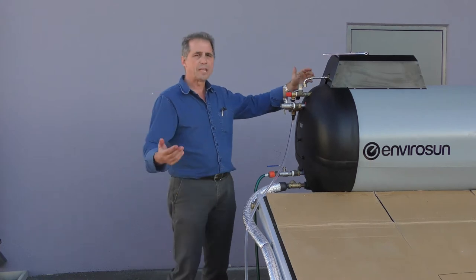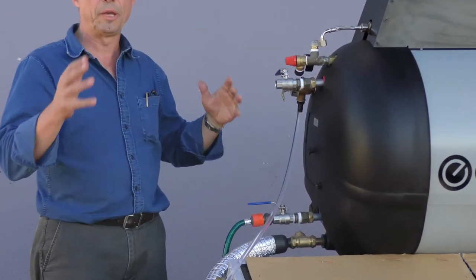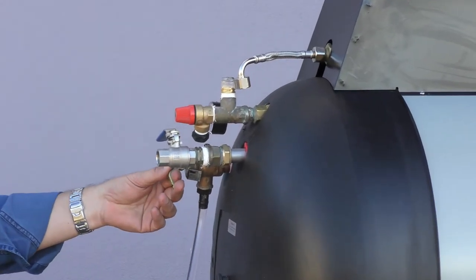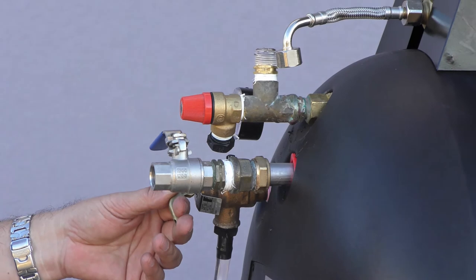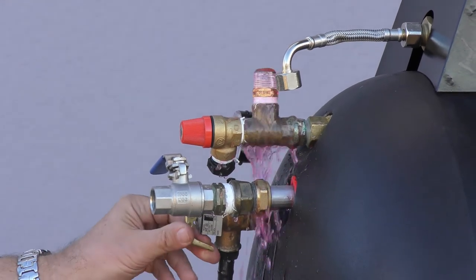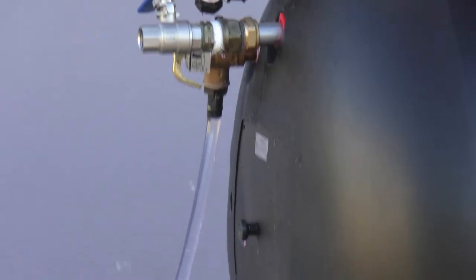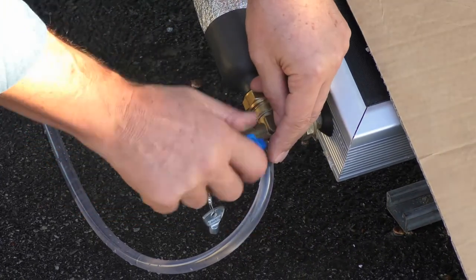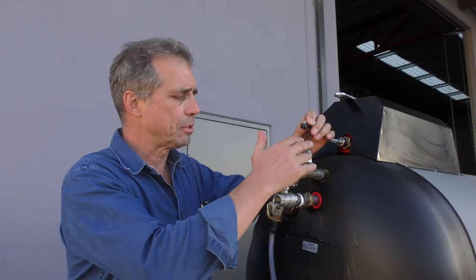As I said, it's important — not so much today, we're not going to get any frost tonight, tomorrow will be a nice sunny day and we'll get a nice bit of mixing. But if you're in a location where that night could be a frost or a freeze, you do not want it so it's not mixed — you want to mix it nicely. Just keep your hand on the PTR valve stem here to make sure that when you start seeing it come out it doesn't get too excited and run all over the place. So we've got the fluids at the right level — see it's nice and pink, a bit diluted. We're going to close off this at the bottom, make sure that's shut off. So we've just buttoned that up, it's nice and tight. We're going to take our fill hose off now — undo the hose clamp — and away you go.